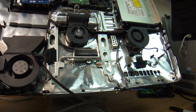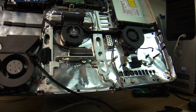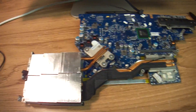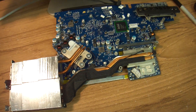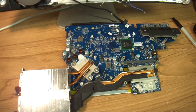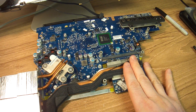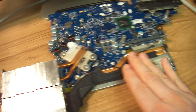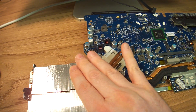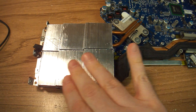So let's take a look at what else could be wrong here. This is not the first time I'm checking this computer out and I've already found out what's going on — it took me a while. As I was checking it, I noticed that this part was really hot — I mean really hot like iron — but this part wasn't. As opposed to the CPU, this is the graphics card. The CPU was warm here and warm here, so that led me to believe that somehow this is not being cooled off.